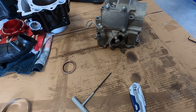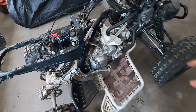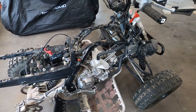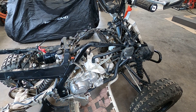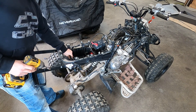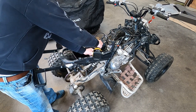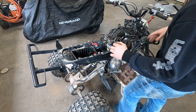I did some more research on this and it's an AIS system — air induction. It'll suck in air from the boot right here and from this valve. So it goes to this valve and all the way back, and this is where it attaches to that boot. I'm going to delete that just because I don't like extra stuff there that doesn't need to be there, and apparently it helps with popping on deceleration. Sometimes that valve can get stuck open too, so I'm going to take that off. I also put a heat shrink plug into the boot so air can't get through that.